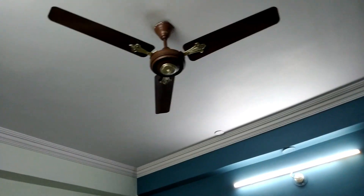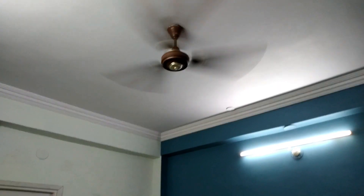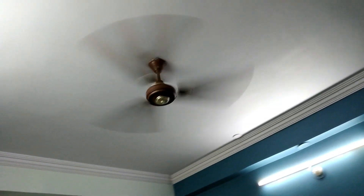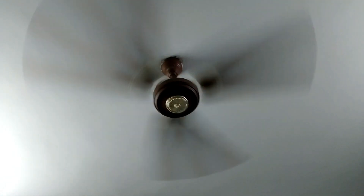Now the 3-star with XLR blades - let's do a test. Being a 16-pole motor, it's not spreading much air with these blades, but it's good enough to give you sleep. Compared to what these blades gave on the 12-pole XLR motor, it's not as impressive. It's satisfactory, but in peak summer it won't give you much satisfaction.